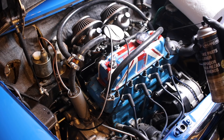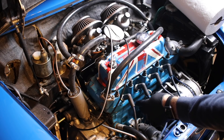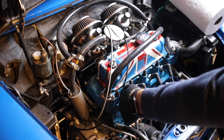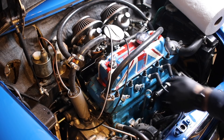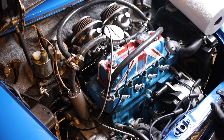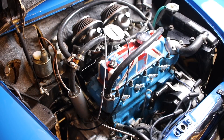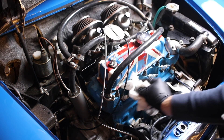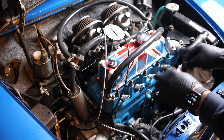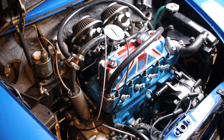The thing you'll want to keep in mind with brake cleaner is that it will take the paint off of things. The paint is already starting to flake on this block for whatever reason — it just didn't get a good coating when I initially did this. But I'm going to take this stuff off and get it all cleaned up, and then we will replace the valve cover. Alright, so that is kind of tidied up. It's not perfect, but I'm really not going for perfect right now. I just want to get this oil leak fixed, and then we can go for perfect later when I do a head replacement.